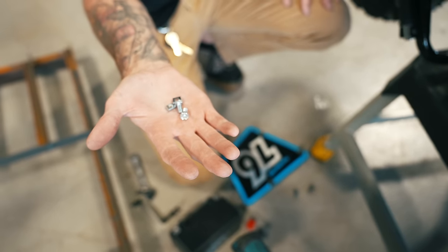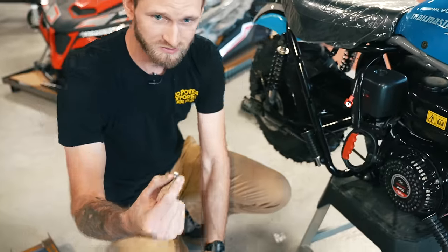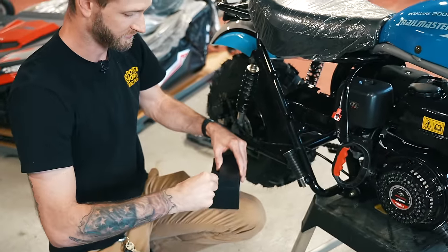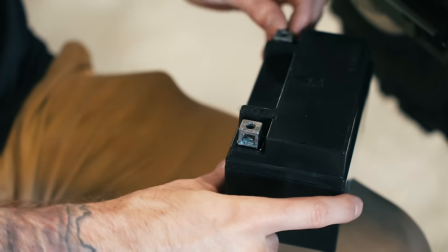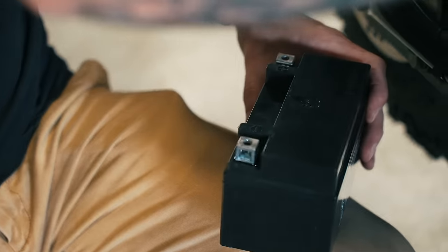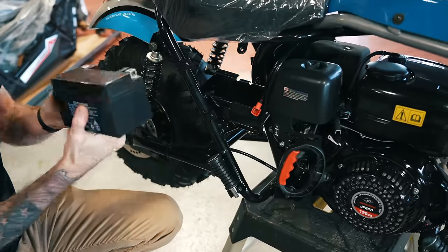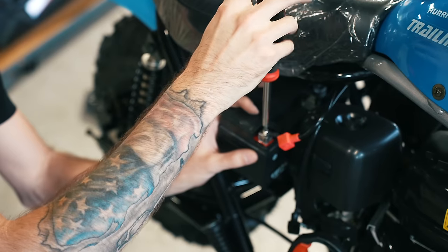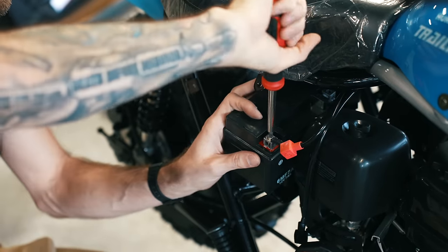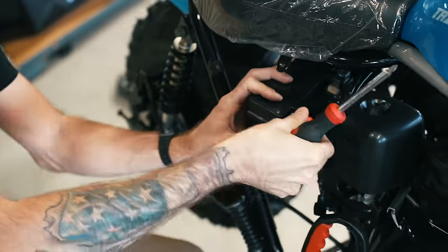This is your battery hardware to mount the battery cables. These little blocks slide in under here so you have something to thread into — on both sides. If your positive cable is the shortest, you want your positive on this side. You have to be careful because those little blocks will fall out and they are a pain to get back in. Get them nice and snug.